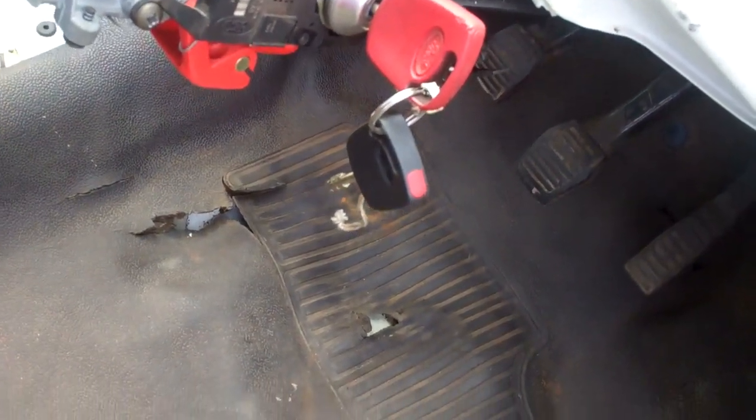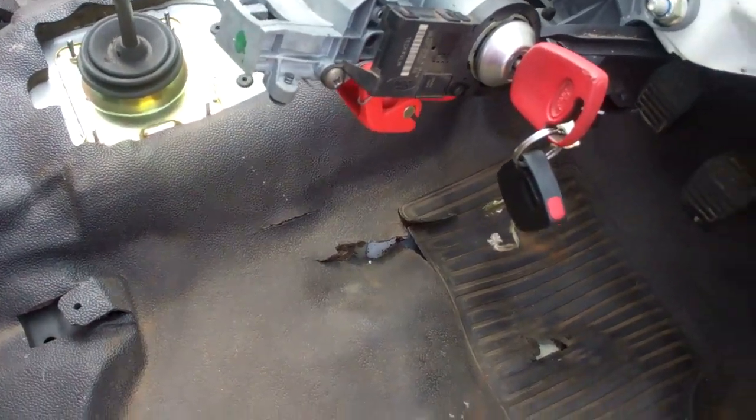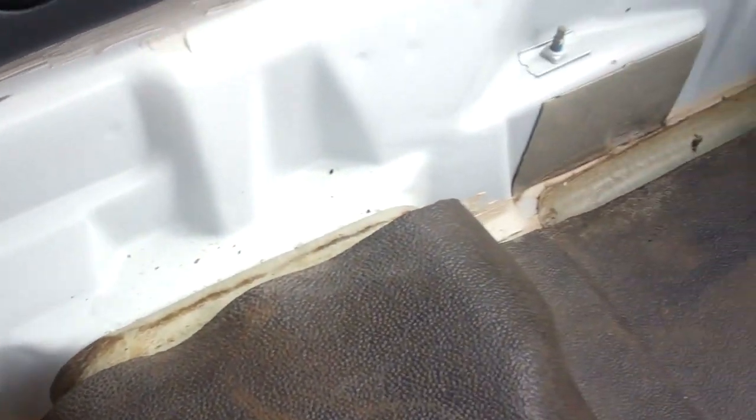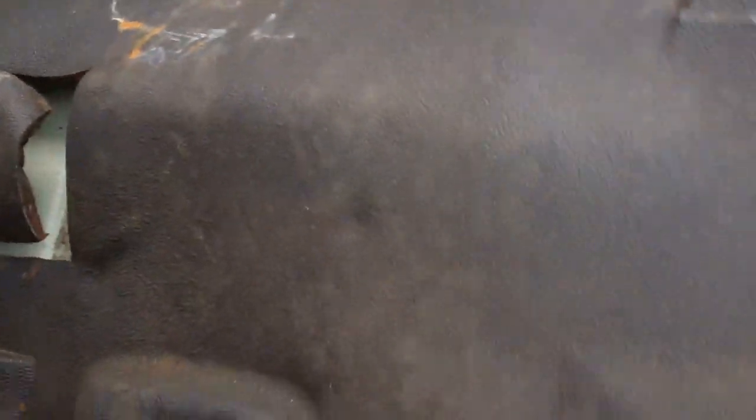I've had to change the ignition barrels. There are codes in that — that's a code reader for the ignition barrel — so I've had to swap all of that. Other silly little things are different too. The fuel sender for the fuel gauge — can't even find where that goes — and the hole is a different size from this for the rubber grommet and plug. So I've had to open it all up for the wire to go through to the sender units at the fuel tank.